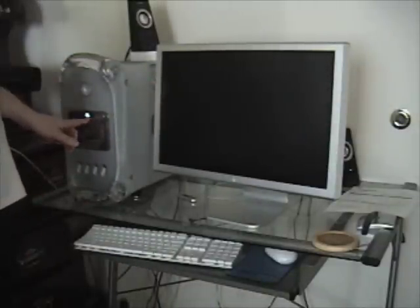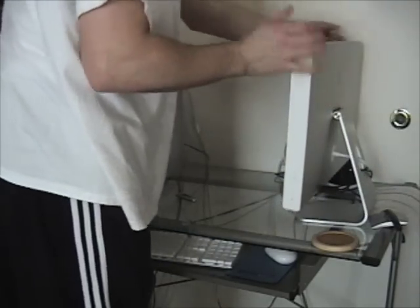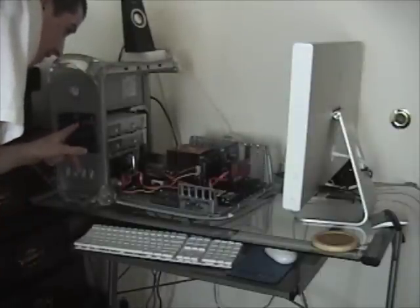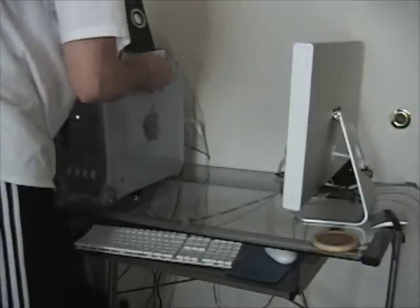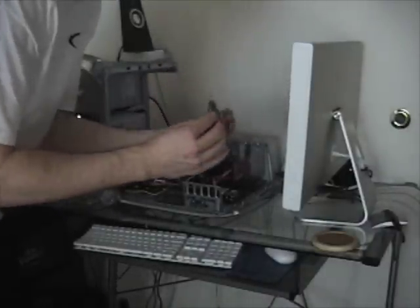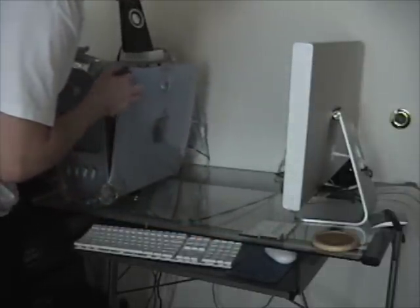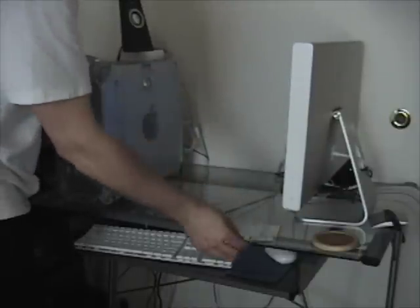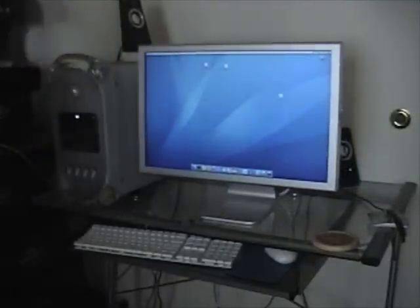Here we go, fingers crossed. We've got a nasty sound back there — it sounds like it's the card. Looks like it's hitting on my drive cage bay. I'm going to take this end plate off right here because when the case closes, the fan sits right on top of it, and I think that's what's hitting. Yep, it was the end plate — and she works!